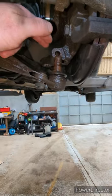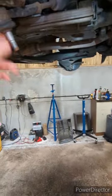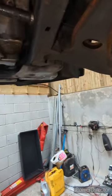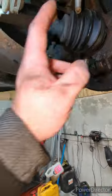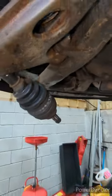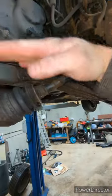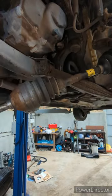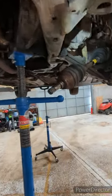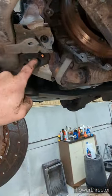Lifted it up. Taking the bottom ball joint bolts out on an 18. Took the track rod off — that's also on an 18, same both sides. That's allowed that to be pushed out. Just pop the drive shafts — same on this side, this one's a bit more awkward. If you push it enough that way, you can actually pull it out and it will drop down. So they're both out — axles and drive shafts are out.